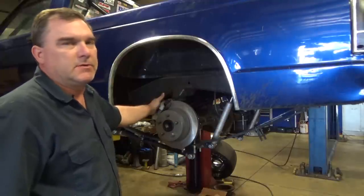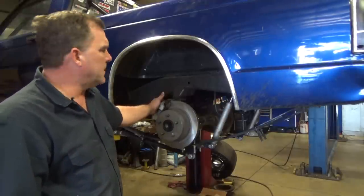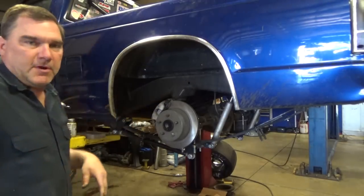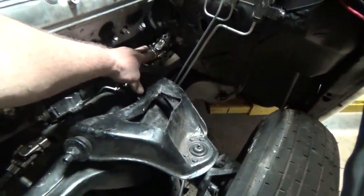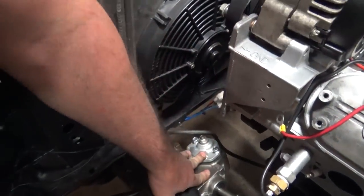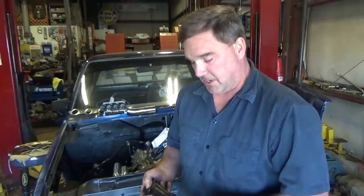I'm waiting on ignition coil relocation kits. I'm going to mount my coils on the firewall and make a custom set of plug wires to run down — that way I don't burn plug wires. I'm placing them on the firewall so I don't need to buy extensions for the harnesses, which saves a few dollars. This thing has come a long way from where it started. I've got my lowered column with my joint — it's going to come out right underneath my header. I need to cut a piece of three-quarter double-D shaft for my steering linkage.